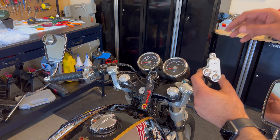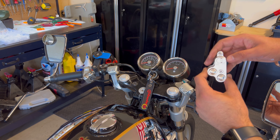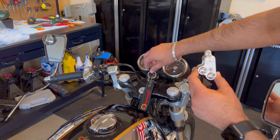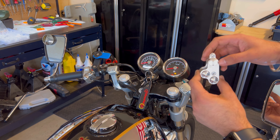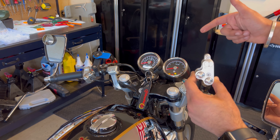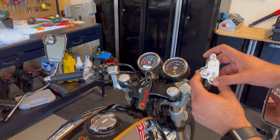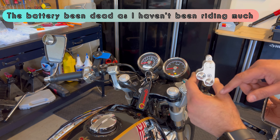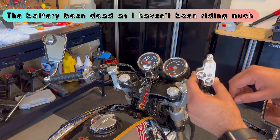I'm doing a quick test for the kill switch just to see the wires are connected correctly before I mount this. It is currently in the kill position so the fuel pump shouldn't turn on. Once it goes to the right side you should hear a noise - there it is, that's the fuel pump. The battery's dead but we know the starter is working, and then that's your kill.